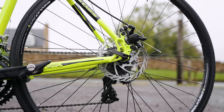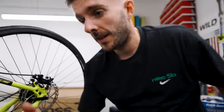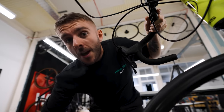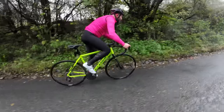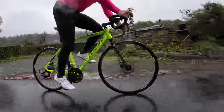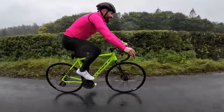It has cheap mechanical disc brakes, and unfortunately both of them are rubbing straight out of the box. The rear wheel was already installed, so whoever set it up did it badly. The disc rotor is not completely true on the rear. It's very minimal on the front, and I think if you rode it a bit and bedded in the brakes it might go away. I've been riding hydraulic disc brakes for a long time — mechanical disc brakes are not as good. They do work, they do stop the bike, but they're worse in the wet. Are they better than rim brakes? Yes, a bit. Are they better than hydraulic? Absolutely not. I would actually prefer rim brakes at this price point — the only limitation is tyre clearance, which this bike doesn't really have anyway. For this bike particularly, I wish it was rim brake.